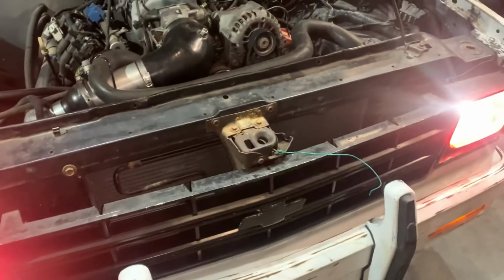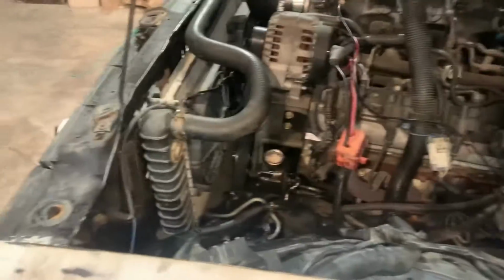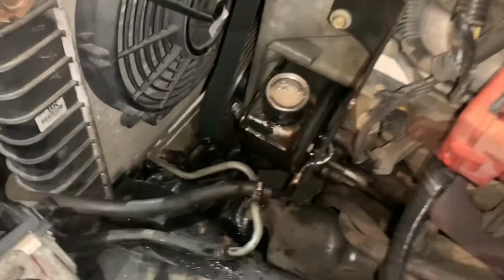I underestimated the capacity of the system, and it sucked it all in as soon as I started up and got air in it. Pump started whining, so we shut it off, put some fluid in there, and now it's not whining right now, but I'm scared to turn it. It's got a bunch of air in there. I'm gonna turn it really slowly. Film the bubbles.